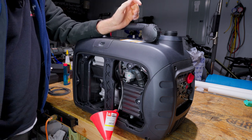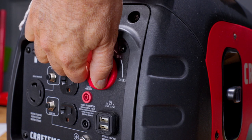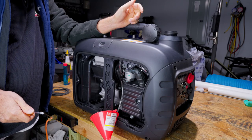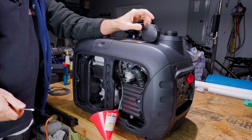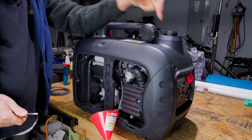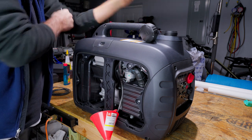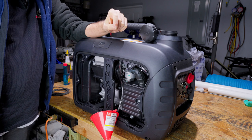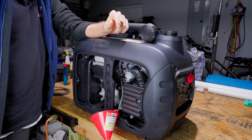You're going to want to make sure that your fuel selector switch is on — if you have one, or fuel cut-off, make sure that's on so it'll draw from the tank. Make sure the gas cap is off so that you have air behind the gas, and just let it sit there and drain until it's as empty as you can get it.